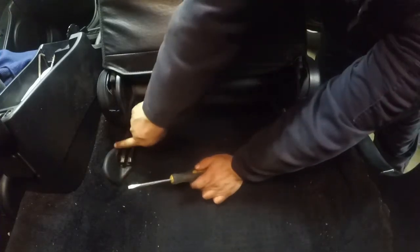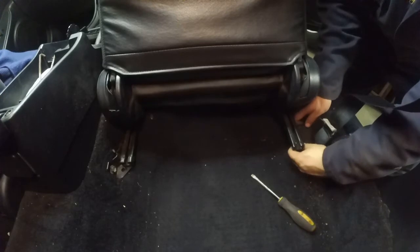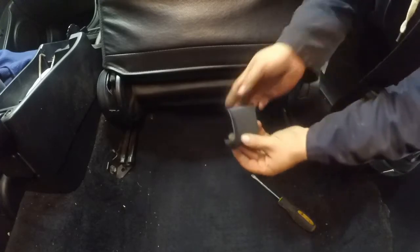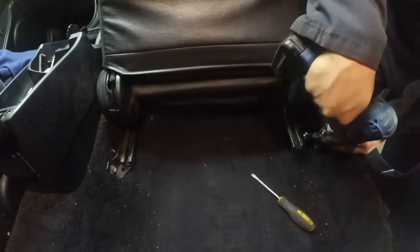For the left cover I find it easier to pull out using a screwdriver - you need to push it upwards with this kind of motion. For the right side you have to prise it open by pushing side to side on the plastic, as you can see there are two plastic tabs - just be careful with them. Then it's a 13mm socket again, and I find it easier to install an extension in the socket when removing the bolt closer to the door.